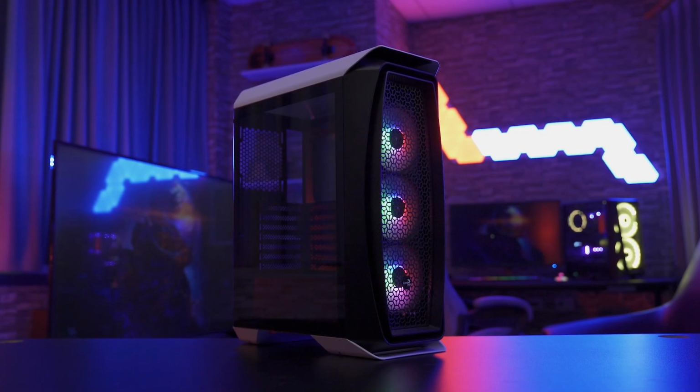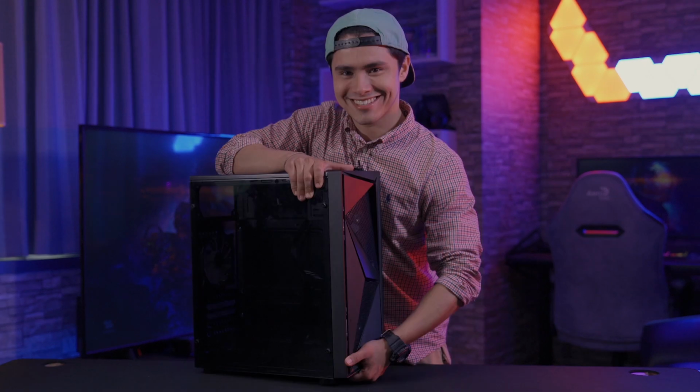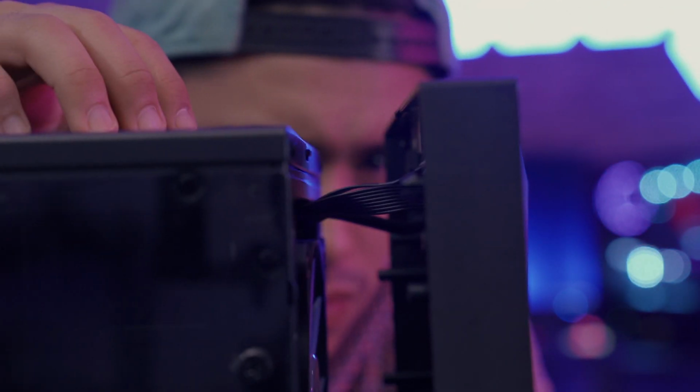It is very important that you don't feel too scared or nervous when pulling the panel. You can actually use a little more force than what you had in mind. The front panel was actually designed to be removed in this way. Here you can see some examples of how you could remove the front panel from different AeroCool cases. Be careful not to pull out the front panel too much, since some cases have cables connected to the I/O panel.